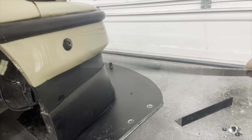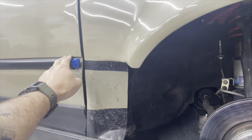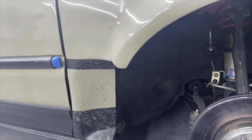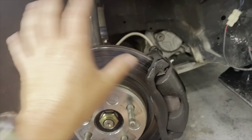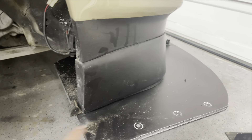We had a bunch of ideas. Essentially on the other side, I'll have one of these going through here — I'll remove this one but the other ones stay attached. I'll get some sealant there, remove the one up in the fender and the one right here, and it'll stay on the bumper. I chose the thinner ABS because it flexes — which might sound counterintuitive, but with it being able to flex, I should be able to pull it off by just removing one tire spat. Hopefully this just nets good results.